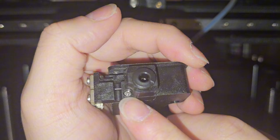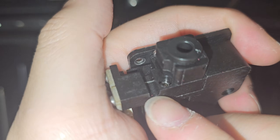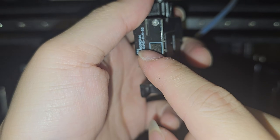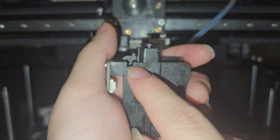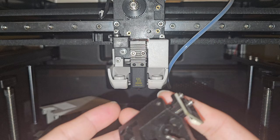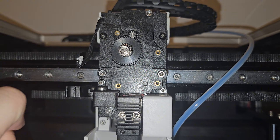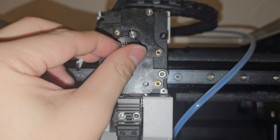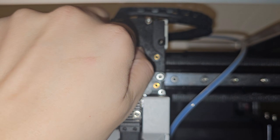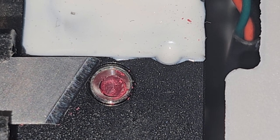What I think is, if you take off this screw right here, this piece is going to come off. I believe there is a small spring in there — when you push in the filament, it's going to hit the spring, and this is the filament detector. So if you take this part off, the spring inside might pop out. I don't want to deal with that, so I'm just not going to take this off. This is a really simple design like most 3D printers. These are your filament gears. Right here is a gear that drives your filament gear, and that is the motor gear up there driving this gear, which drives your filament gear. It's a pretty simple but really cool design. If we look down there, that's the PETG carbon fiber — pretty nasty stuff.